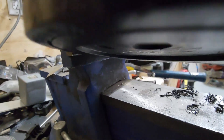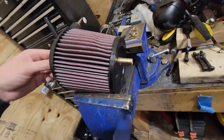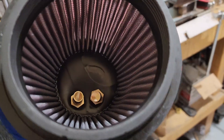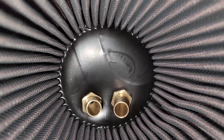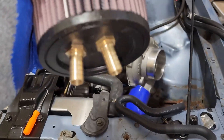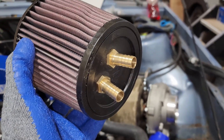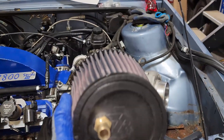These will go in here like so — they'll just kind of pop out the bottom. They're going to be a little loose since it is rubber. You can get metal filters too but they're more expensive; I just don't think it's necessary. The key with this is making sure these hex nuts don't actually pierce themselves through the rubber because if you tighten them down enough they probably will since it's flexible. I don't anticipate the nuts coming off, but if they do, when you put your hose on with your hose barb and hose clamp clamped down properly, that hose will keep this thing from going back into the turbo. So even if that nut comes loose the hose will keep it there — you'll see if the nut is loose when you look at this occasionally. I'm going to go ahead and install this thing in the car hopefully for the last time.